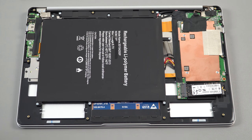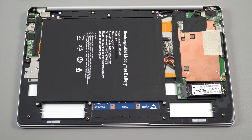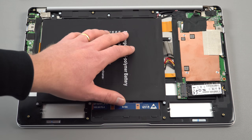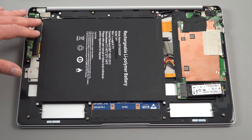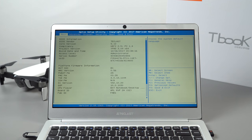Many people ask about upgrading the RAM, but that's not possible here — there are no SO-DIMM slots in the N3450-based devices. RAM upgrades via SO-DIMM are only possible on some Celeron mini PCs. The internal layout and build quality look good overall: plugs are all taped in place, so if you drop the laptop they shouldn't pop out.